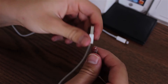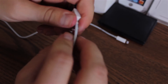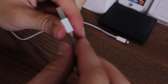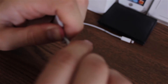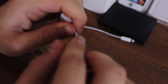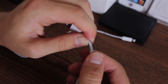Go ahead and put the spring onto the first part of the lightning cable so that it sits on the cable. Once you have that, gently hold the spring. If you fail, don't get desperate — just try again. Hold it with your finger and start rotating the spring clockwise. You should see that the spring is getting onto the lightning cable pretty well. Keep doing that until you have almost the entire spring on the cable.